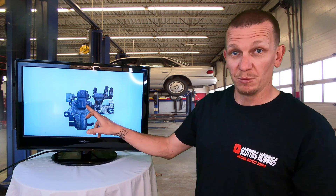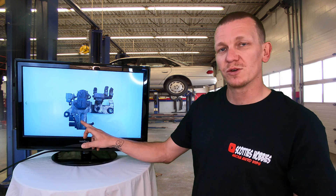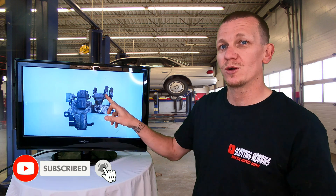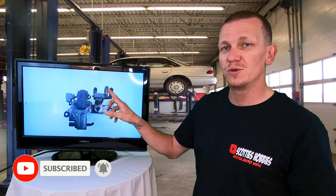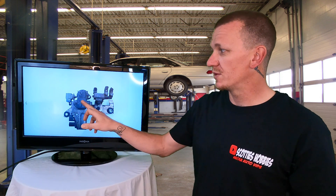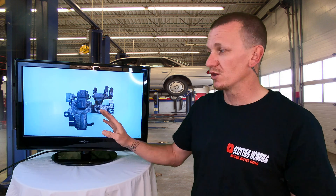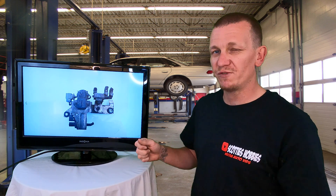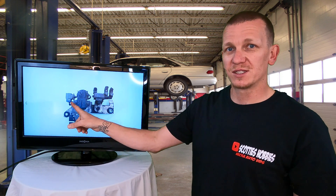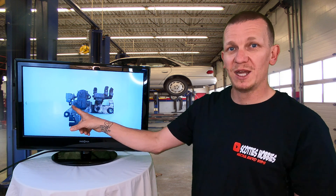On the bottom side you have an EGR solenoid. This whole component is on your passenger firewall. Right here you have the boost sensor — it even says 'boost sensor' on it. On the bottom side is your EGR solenoid, and this is your emissions vapor purge solenoid that goes to the intake manifold and to the canister. First thing you're going to check is all the hoses to and from everything — look for little cracks or anything frayed or falling off.